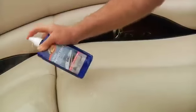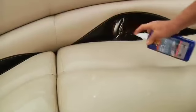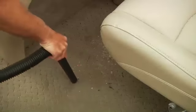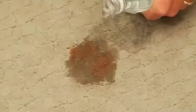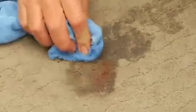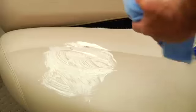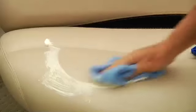Your boat's upholstery will remain new-looking longer if you treat it with a UV-resistant vinyl spray at least once a month. This is also a good time to vacuum up sand and grit that might ruin the finish, carpet, or upholstery. With liquids that might stain upholstery or carpets, including fish blood, wipe them clean with cold water immediately. For other spills, use carpet or upholstery cleaner, wiping away residue with a clean towel.